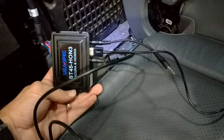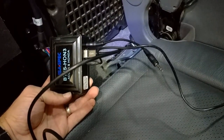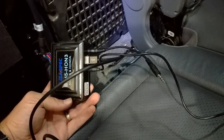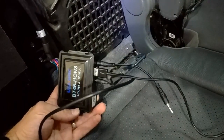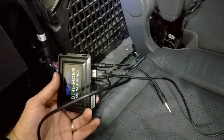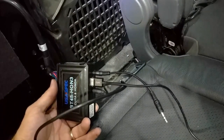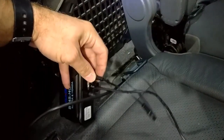At this point it's all connected, and I would encourage you to test everything before you put the seat back together. I've got the USB connected to test the charging and that's working. I've got the microphone running to the front of the vehicle where I'm hoping to snake the cable to the windshield center area. The aux jack is plugged in as well. Everything seems to be working once I've reconnected the battery and keyed in the security code. On the XM one band, preset four is Bluetooth and preset six is the aux input. The one concern is that the cable connection here feels a little loose.